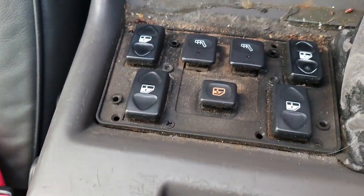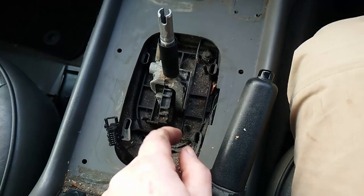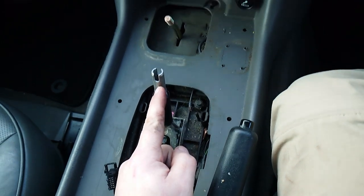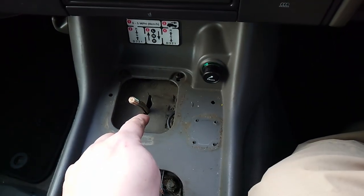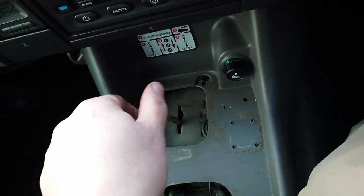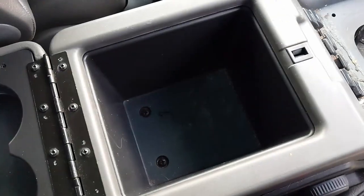There are a couple of screws at the back. These are quite easy to take off. You literally pull the automatic shifter — you just pull it out. It'll come off. With the transfer box you can see it's threaded, so you just unscrew it, pull the cover up and unscrew it. It's quite simple really, and that's how you get it off.